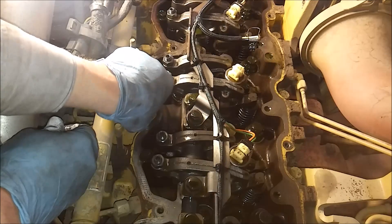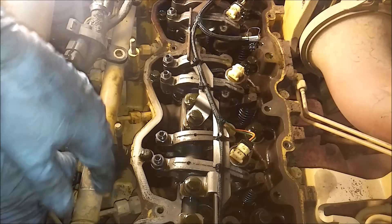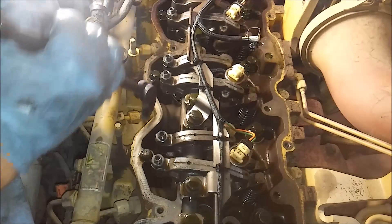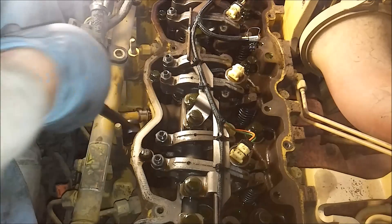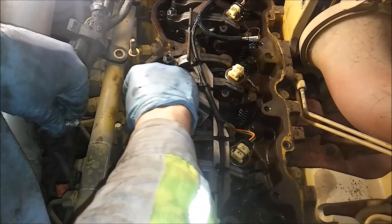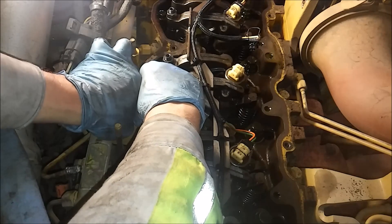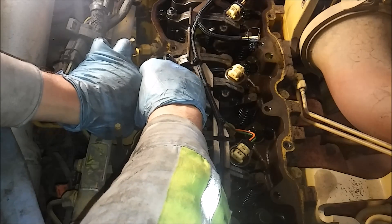So what I do is I take that jumper line that I just removed. If there's enough room, you can pop it out just by pulling on it. This one, not quite enough room, so try to put a little pry bar in there and just pop it out. So it's popped out - quill tube is out. Now you take your jumper line back off.